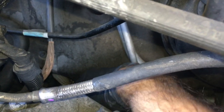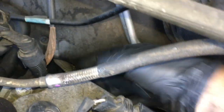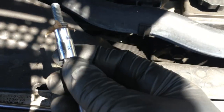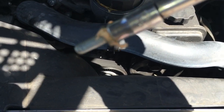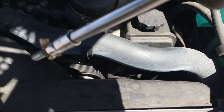Take your new sensor, plug it in like this, and then just reach back here and install it back into the slot and the hole where it came out of. After you do that, I like to take a piece of paper and stuff it in the socket, put the bolt in the socket — that way you can hold it upside down and it won't fall. Now you can feed it in there, start your bolt, and tighten that down.